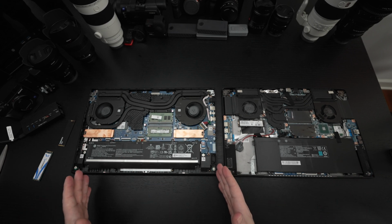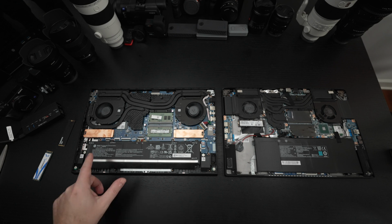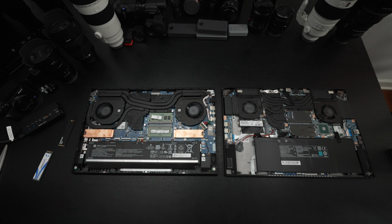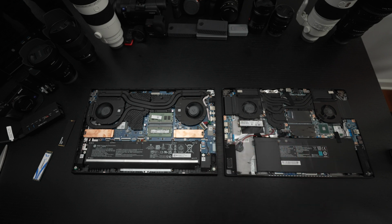You know, if you don't use the 330 watt brick that comes with the Omen 17 and you use an HP 230, it'll work, it'll charge it up, but you will not get the full performance out of the CPU-GPU pairing. And also, I don't think it's a huge deal that the secondary slot is not Gen 4. I prefer having two Gen 4 drives. That's clear. We're in the 11th generation Intel chipset lineup. That's one of the key advantages over AMD's offerings.